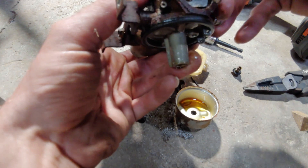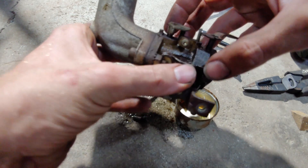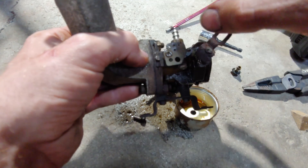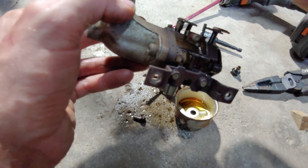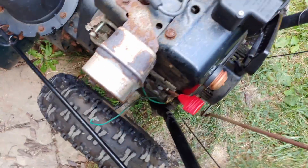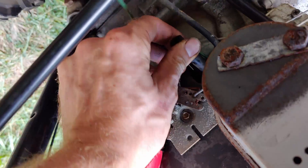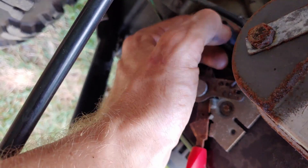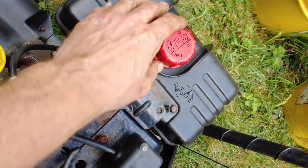When I put that all the way, it takes a second to spring back, so that needs some lubing up. I tried to pull the whole fuel line through here but there was a ton of resistance - I don't feel like having to try to string that back through. So I'm just going to flush the whole thing with the fuel line and the fuel tank on the snowblower. Then take compressed air and throw it through here to get all the water back out, and let the fuel tank dry before I put gasoline in.